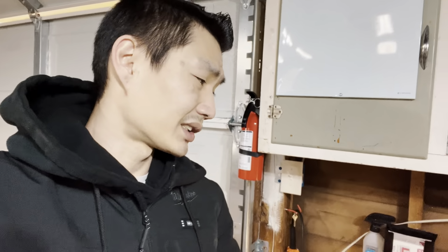Just a couple hoses need to be plugged in, and realistically all you need is a 10 mil, maybe a pick, and this fuel pump remover tool. People have done it with a big flathead and just smacking the ring with a hammer, but I was not about to do that. This tool was expensive, being $47, but there's adjustable $15 ones on Amazon if you want to cheap out, but I didn't want the tool coming loose and having to keep tightening or adjusting it. So this was really neat, this fuel pump remover tool.